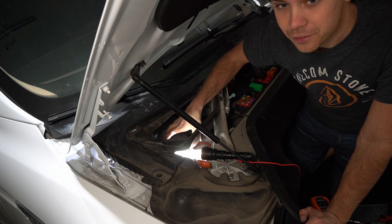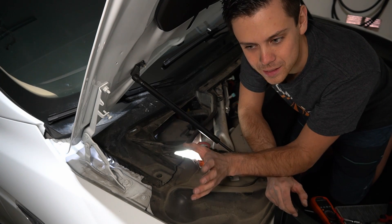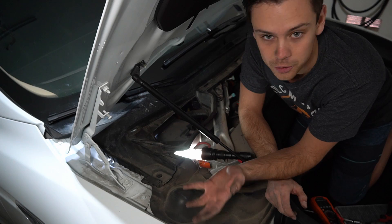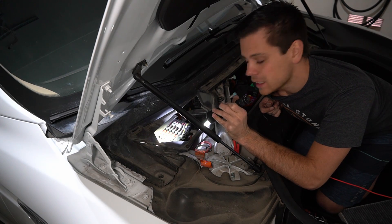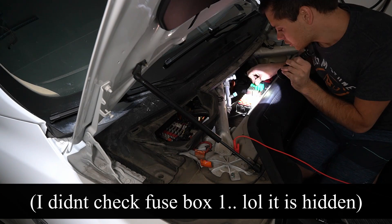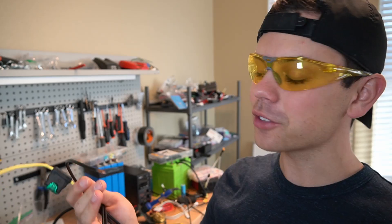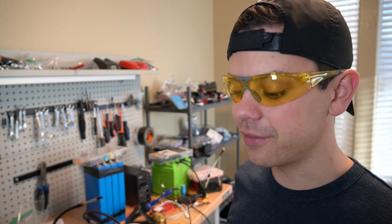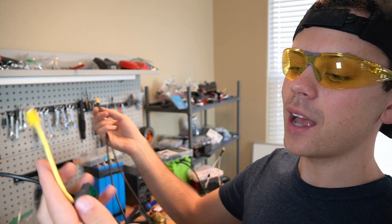After searching online I found out there's a 50-amp fuse at the battery that supplies those terminals, and I blew it. Because it has a 50-amp fuse, the max you should pull from those terminals is 40 amps to be safe — that's the standard 125% rating for OCPD. After checking all fuses and thinking about it for a day, I realized the wire gauge is too small on those jump-start terminals and I don't want to pull off that fender cover every time. So I'm going to wire up a 12-gauge cable to an XT60 connector, which can pass 25 amps.